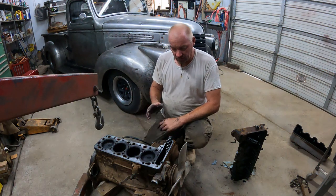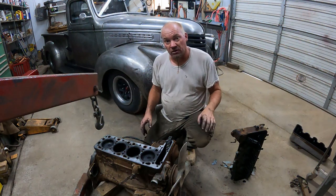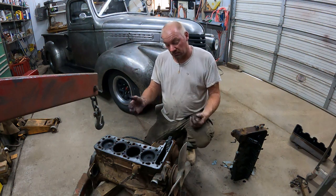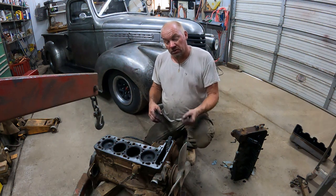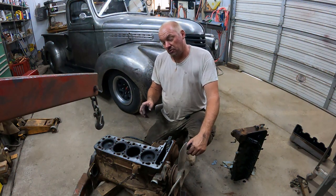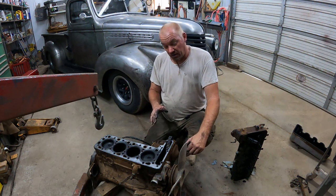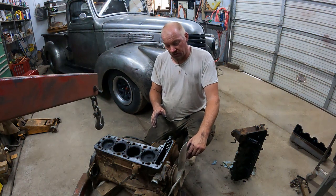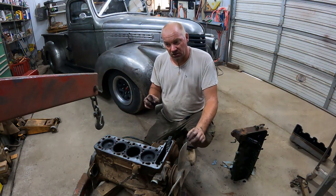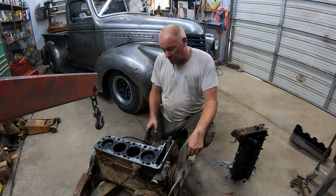So again, turn the engine around till you are at 45 degrees, 40 degrees before. Start building up pressure with the hand primer pump, and then you see the steady flow. Keep turning the crankshaft slowly forward. At 30 you should feel that your stream is already a little different, and by the time you hit 26 degrees it should stop. Every 10 to 15 seconds you just have a drip, and that's it. Do it twice, tighten the pump.